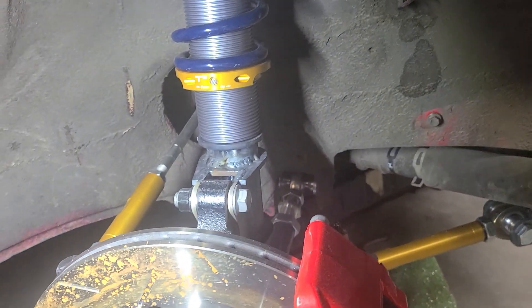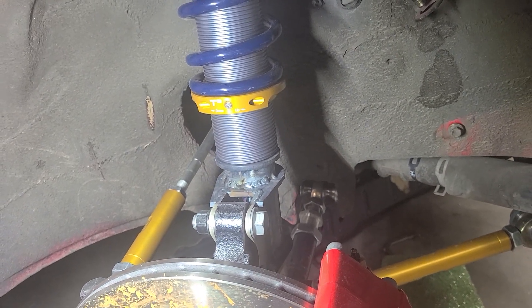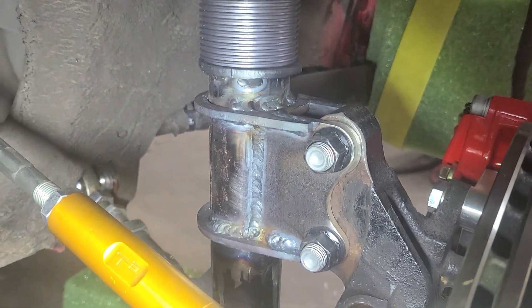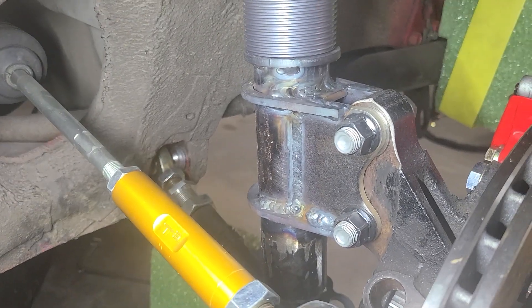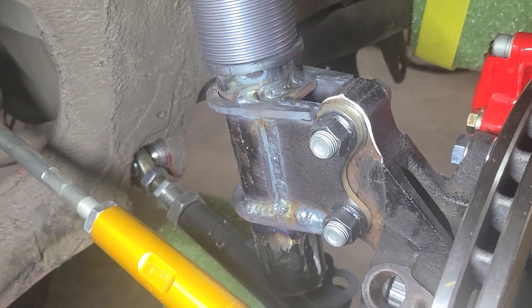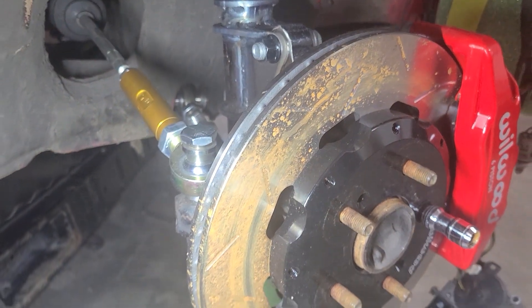For those familiar with the second-gen MR2 chassis, they don't really fit an 8-inch-wide wheel without quite a bit of work. My approach is probably different from most — I've actually modified the factory strut housing, since the strut cartridge itself is removable from the housing. I got a nice chromoly steel, water-jet-cut piece — my own design — and I added an extra 10mm offset to it. That gives me plenty of clearance for the threaded coilover setup and my 16x8 plus 35 wheels.